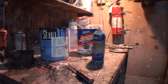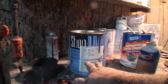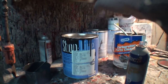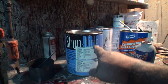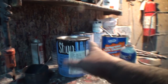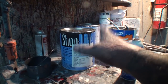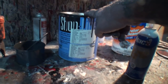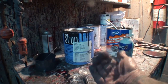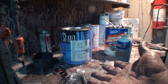The only place you're not going to save money is with the paint — the big corporation knows you need it. I told you the price on this paint, but if you use ShopLine Plus — remember that word 'plus', not just ShopLine — it's identically exactly the same thing as DBC. But if you use just ShopLine, you're going down into the Omni group of paint. Omni paint is the cheapest paint you can buy — it's junk, it doesn't cover. The reason I use ShopLine Plus is because DBC has gone so outrageously sky high I can't make money using it.